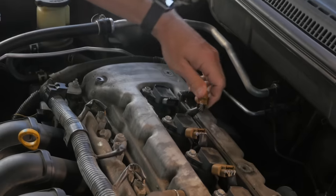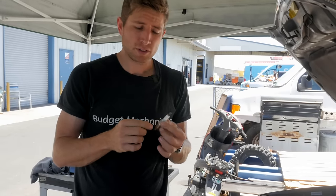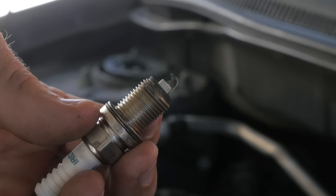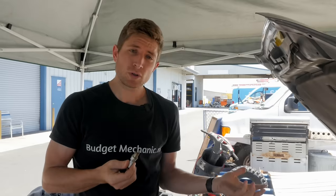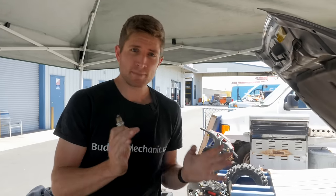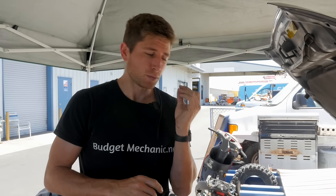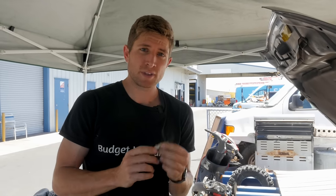Second thing: spark plugs. Spark plugs burn the fuel and create the power. If they are worn out or contaminated, they'll make your engine run rough for sure. You've got to remove your spark plug to check it out. When you're pulling it out, you're checking for things like leaking oil down into the cylinder, which would contaminate a spark plug. When you get it out, you're looking for a burned-out electrode, too big or too small of a gap, or if it just looks corroded and old. Cars are meant to have their spark plugs changed at set mileages, and a spark plug can actually be failing without any physical signs, so a new set is cheap and eliminates that problem.